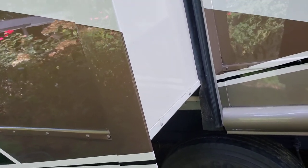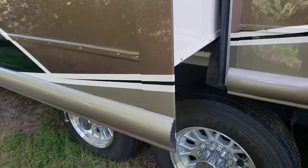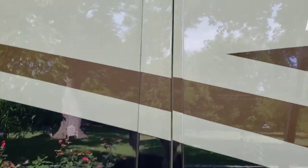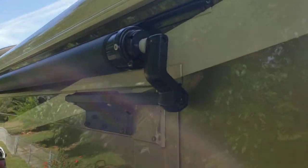I've been playing with this for about 15 to 20 minutes now. So we've got two things going on here. I need to go ahead and bring in the slide — I've got it so it's not binding up anymore, it is making clearance now, so the box itself isn't hanging up. But what's actually happened — see this huge gap here — this just wasn't set right at the factory probably. Look at the top: see the little gap up here and how wide it is. If I correct that gap we get in a bind and we hit. So Anita, go ahead and put the slide out.